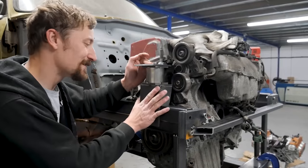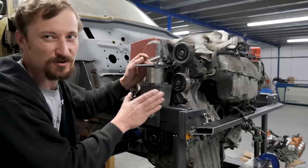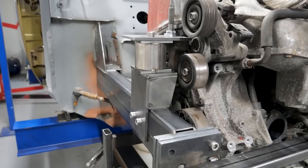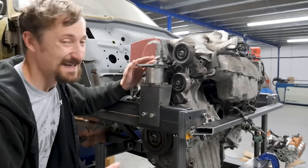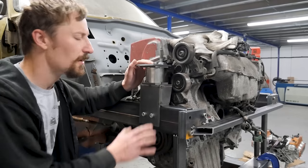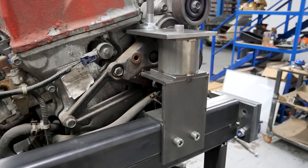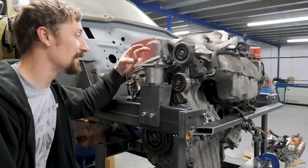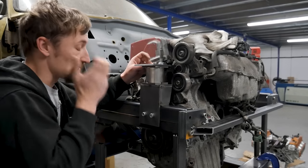So this is what I've come up with for the other side — same as the first side but straight into the chassis leg, top and through the sides, keeping it all nice and square. I know it doesn't necessarily look the prettiest, but I don't think you're going to see these engine mounts anyway. I'd rather they were strong first and look pretty after. When we weld them they'll look a bit more impressive. The only thing I haven't done with the top is reinforcement — it's just a plate at the minute. I'll probably add a gusset at the top, and then we'll also need a torque mount.